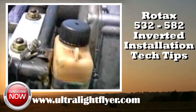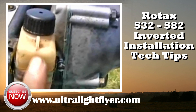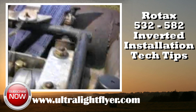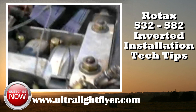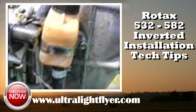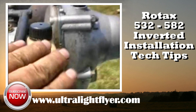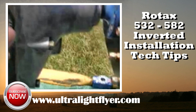Failing to do that will in most cases result in engine failure upon startup. If you have a brand new 582 Rotax engine and you fail to fill this system with the spark plugs facing up, this rotary valve shaft will almost certainly fail. The brass from the gear will embed itself into the crankshaft and it will cost you three or four thousand dollars. So whether it's a new installation or a reinstallation, make sure you fill this tank with the spark plugs facing the sky, and then do your engine installation holding this tank above the engine at all times.